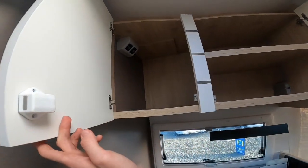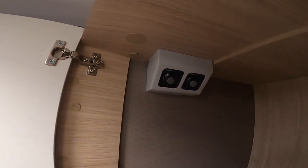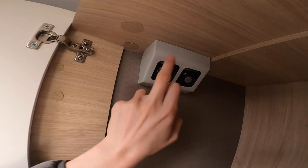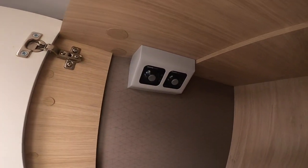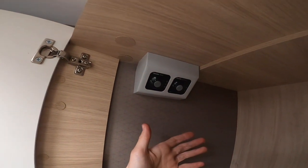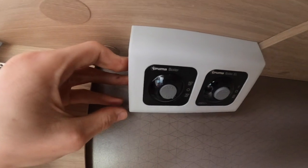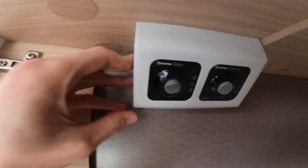Storage, some storage, but in this one you do have your heating controls for your water heater. So your water heater controls, so you've got two controls. This one does the gas, this one does the electric. So the gas is where the cover needs to come off the outside of the vehicle. If the cover doesn't come off, then it won't light on gas. So you've got two options on the gas one. So off in the middle, 50 degrees at the top or 70 degrees at the bottom if heating your water